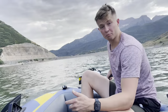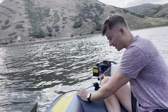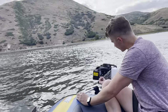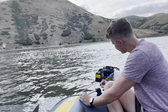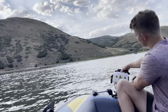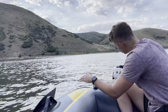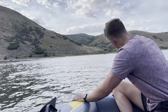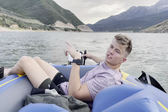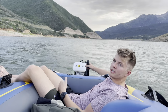It just kind of turned off, but it fired right back up. I bet I know what it is — I see a lot of air bubbles in the gas lines. I'm wondering if the fuel is not sucking it through very well. Let me pump that a little better and see if this will fix our issue. The air bubbles stopped in the gas line, so it's much more reliable now — that's good.